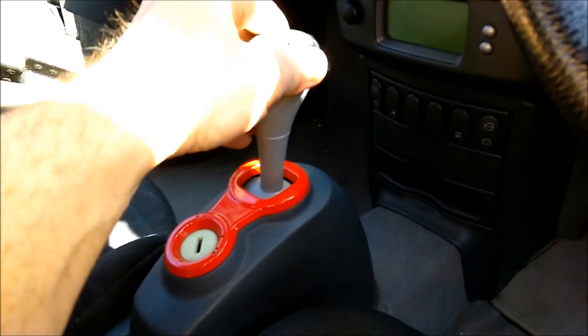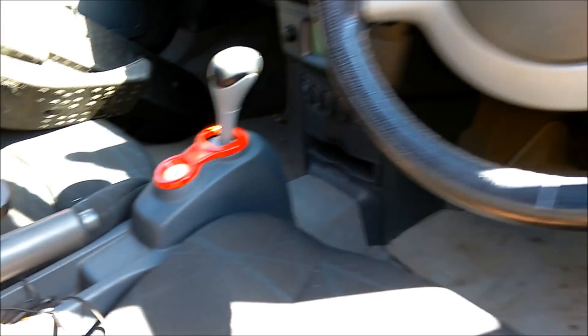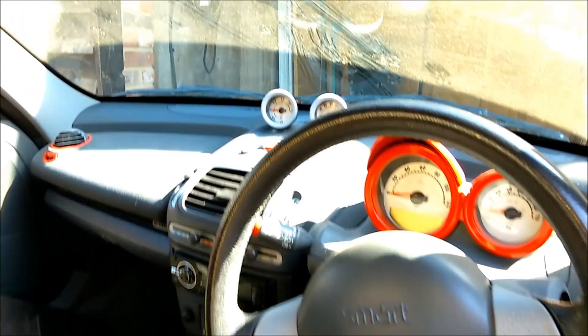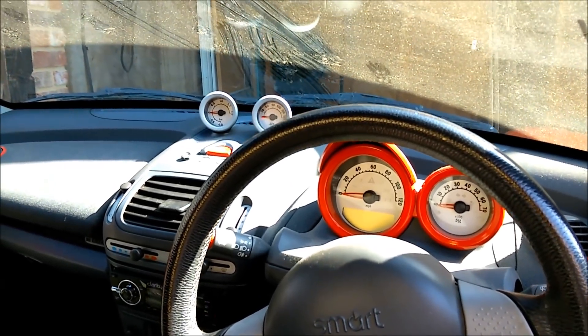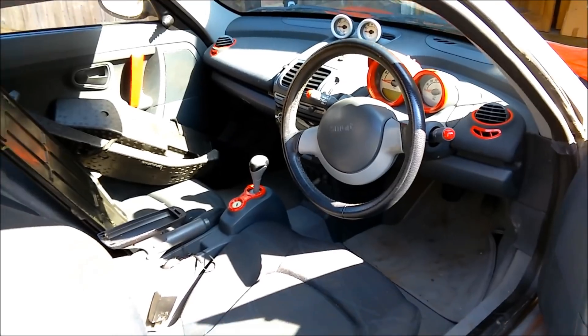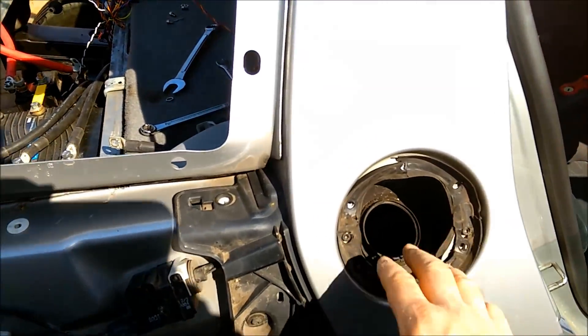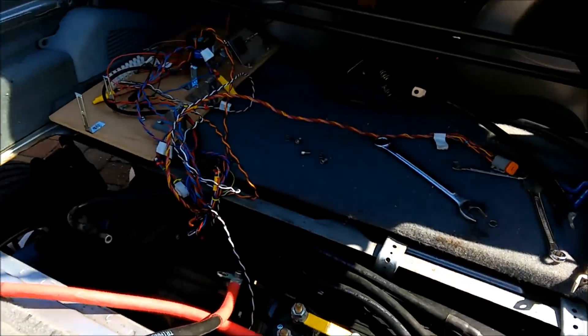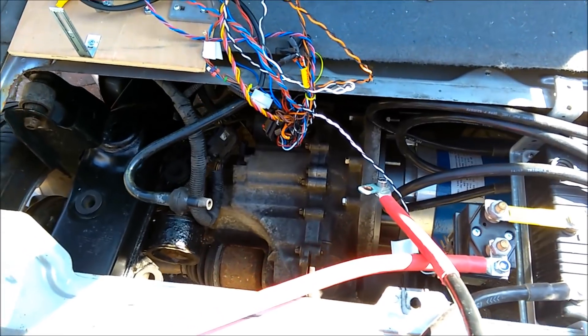I've got the neutral position and I can really make use of this gear stick for forward and reverse - it's quite a good joystick for doing all that kind of thing. I don't think there are any other internal mods I'm going to need as a minimum. I'll just need to try and make the best use of the gauges, and I might try and fool some of the standard control system to give me some of that control without having to put more gauges in. Longer term I can build a touch screen in there for more control over the whole system. And finally I'm going to need the power inlet and a battery charger - I don't know the size of the battery charger yet, but hopefully that's going to sit in that space just above the motor, near the power inlet. The most important thing is to keep all the leads as short as possible, and that helps clarify where things go as well.